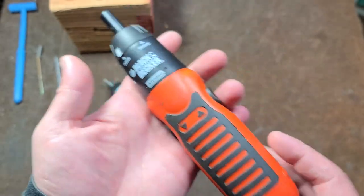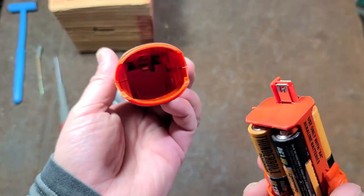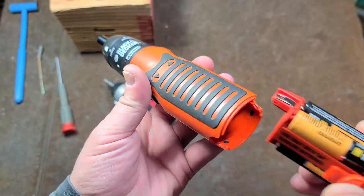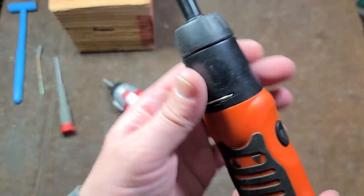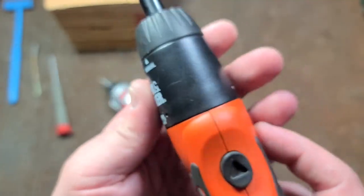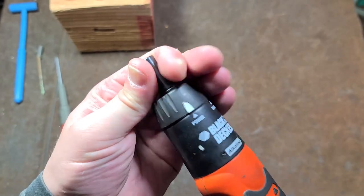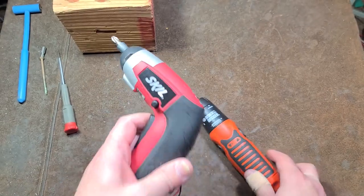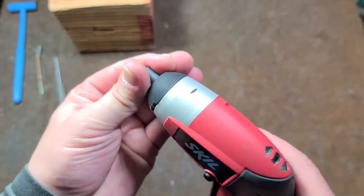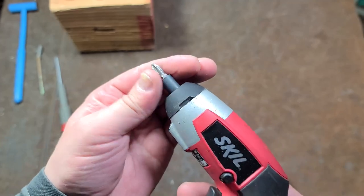They thought about that — this was a cheesy product, like a $10 product. It has a little slide-out thing with little contacts there, and I do have brand new batteries in it. This lower part of the case just snaps together, then the gearbox slides over the top and uses this clip. It doesn't have a lock or a sprag clutch — a one-way clutch — like on something a bit more expensive. This Skil has a sprag clutch, kind of like a one-way bearing, so it automatically locks.